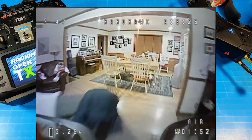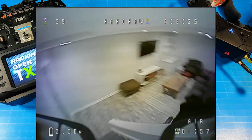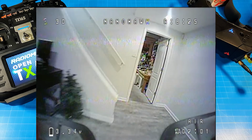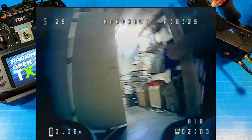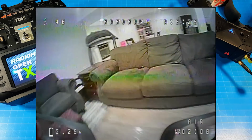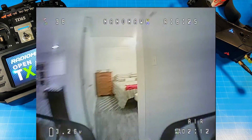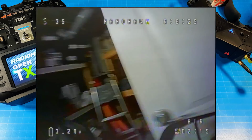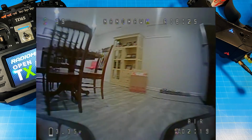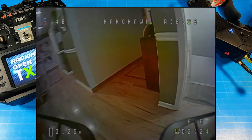So as I was looking to resolve the camera issue, I was kind of playing around with that front portion of the camera that looks like it's separated, and it is, but it's attached on the inside of the canopy to the lower post. So getting that little front camera flap thing out, it shouldn't come forward for one. I made a mess out of my canopy because I did pull it forward, and then putting it back, it all got loose and everything got worse as far as a stable video. So I had to use some glue on mine to shore those things back up. So if you've got one of these and you're going to be tinkering with the camera, do not pull that flap forward.